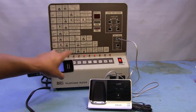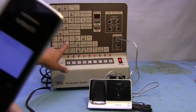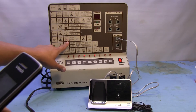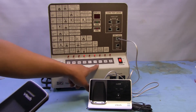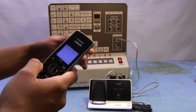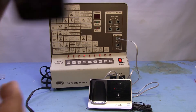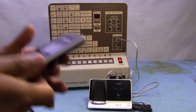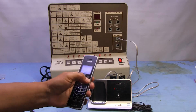Let's hang up and do the receive test. We push the receive button and we're supposed to listen for a dial tone on the handset. If we hear the dial tone then we're doing good and our phone is working fine; if there's no dial tone the unit needs service. We take the handset off the hook, push the talk button, then push receive — and there is a dial tone. Let me put it on speakerphone — there we go, so that is working.